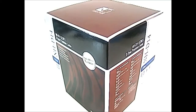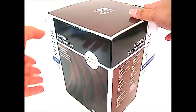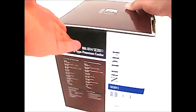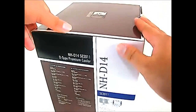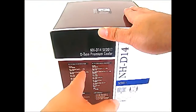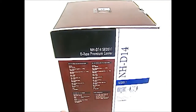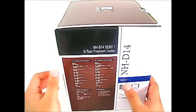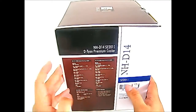As the name implies, this is the LGA 2011 compatible version of the award-winning Noctua NH-D14 6 heat pipe dual radiator heatsink. The packaging is slightly different, especially the box cover, but the features of the NH-D14 mostly remain the same. The new updates include the LGA 2011 mounting, and you'll also get new PWM versions of the NF-P12 and NF-P14 fans.